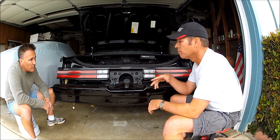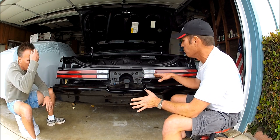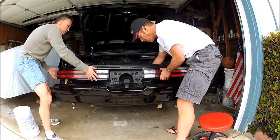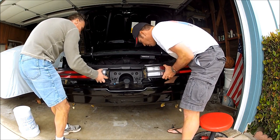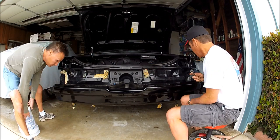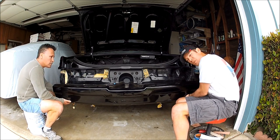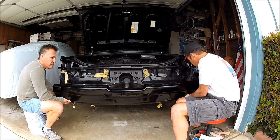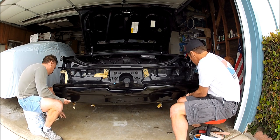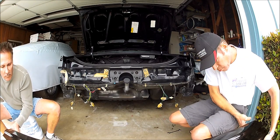To keep the video from being an hour long, I've streamlined it a bit. The first thing you do is take the tail lights out — four wing nuts on each side, slide them out just enough, and remove the bulbs. Next thing that comes off is the bumper. A cool ratchet box helps with the bolts underneath. Some are tricky to get to. With John's help we take it straight out and set it down.